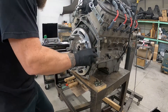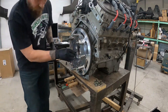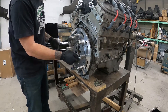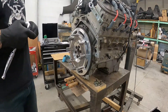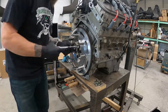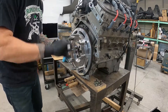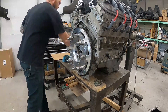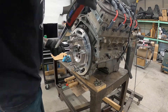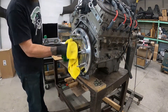Get the flywheel hung on there, sink some bolts in and get them nice and hand tight. Use a wrench to take out the slack and get the flywheel snugged up against the crank. When you go to torque it down, you're going to 85 foot-pounds. Make sure you've got the crank locked into place, double-check all your torques, and then clean it all one more time.